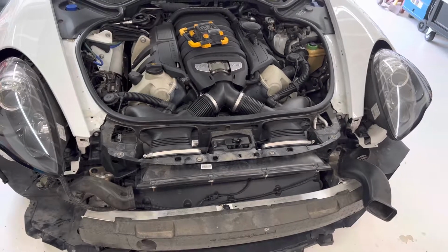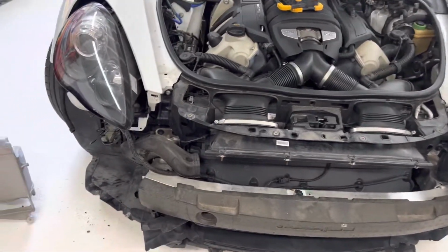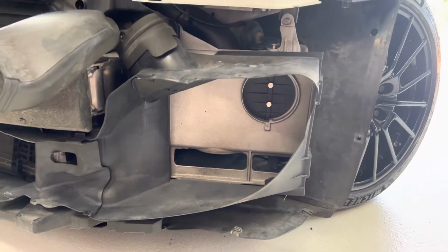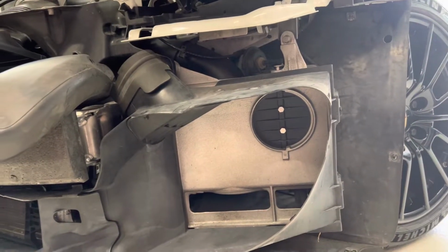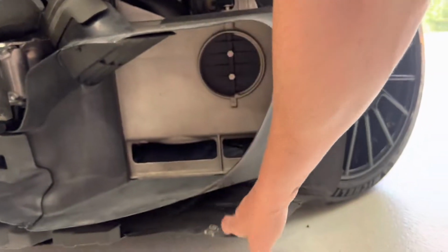So this is a Panamera GTS, and after removing the front bumper and getting everything out of the way, you're left with a piece that looks like this, which you can either pop the bottom section off, which I'll show you in a second, and take the stock replacement filter, which sits here, and pull it out through this panel